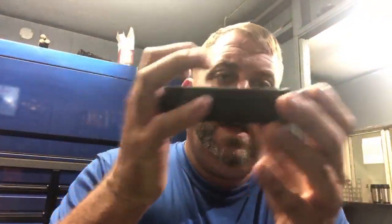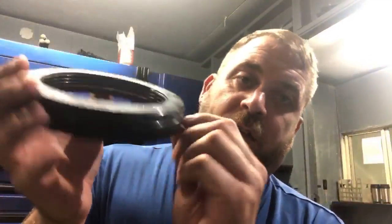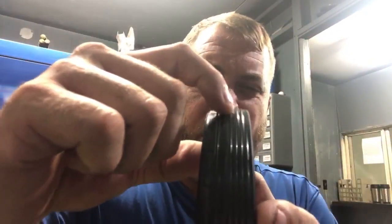Okay, so a lot of you guys, this is the factory wheel seal, okay? It's a Conmet, I think, C-O-N-M-E-T. This is the wheel seal, and it's got this rubber out here over the lining. Now, the problem is that when you push this into the hub, the hub was only coming to about the third notch, maybe. And then what happens is back here on the rest of the spindle, I would say, George, what was it there?